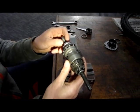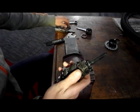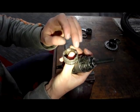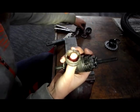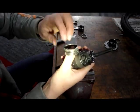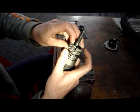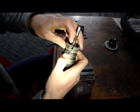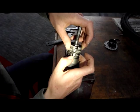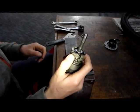That basically completes the reassembly of what I call the guts of the gear. Now we need to install the brake shoes so that the castellations here match with those castellations on the outside. We then locate the split in the brake shoe over this little spring. The sole purpose of this spring is to provide enough friction to actuate the cam rolls which spread the brake shoes.